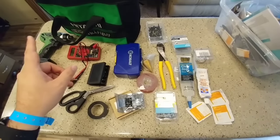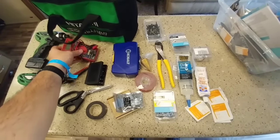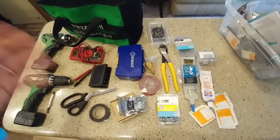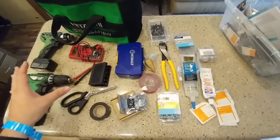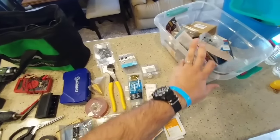On the golf cart I had to find out if one of the batteries was bad — it was nice to have a small multimeter with me just to make sure one of the batteries was putting out the correct amount of voltage. It wasn't, so I had to give it a charge. Everything comes in handy and it's good to just have all this stuff. And all of this actually fits inside this box with what's already in there.